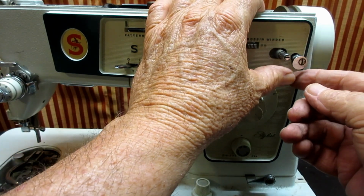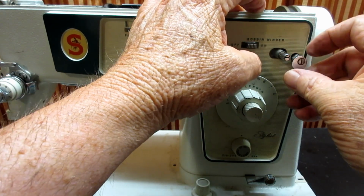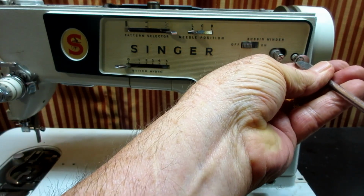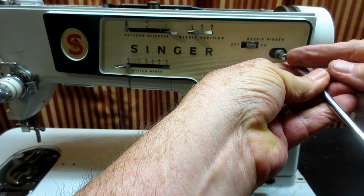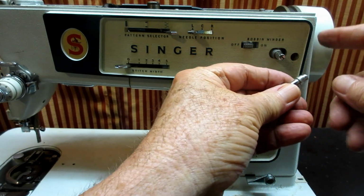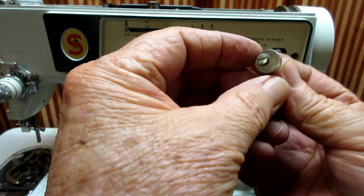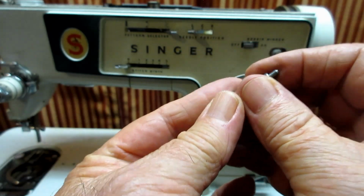This will be somewhere on the inside of the two bobbin sides if you want, so that when the bobbin gets to how full you've set this, the thread has pushed this far enough away that the friction ring or rubber tire on the bobbin winder stops turning. Okay, and this is just off-center front and just a regular screw inside. Okay.